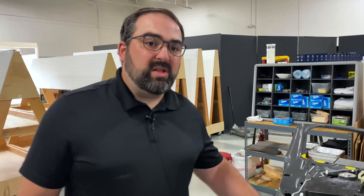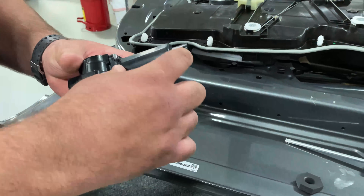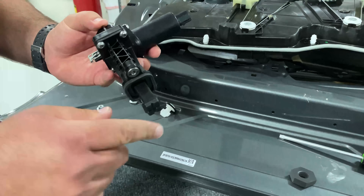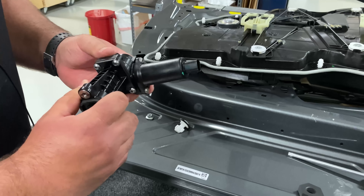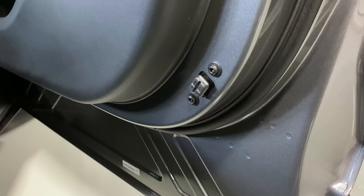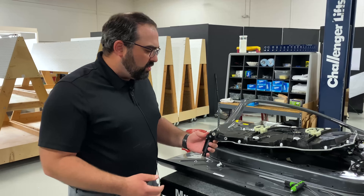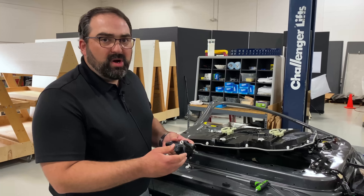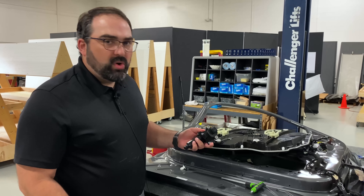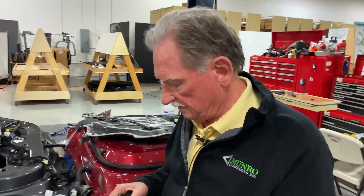The next thing we're going to talk about today is the door cinch mechanism — the kickstand from inside the door. We've taken this one out. You can see the motor on this part, and there's a worm gear that drives the plunger in and out. The worm gear is a very effective design here — it will resist any forces pushing it back in. So when the door is open and your hand is behind it, even if your 200-pound kids are wrestling and run into the door, it won't crush your hand. It's a slightly larger part, but it is a very safe part for how the door opens and functions. I couldn't have done better myself.